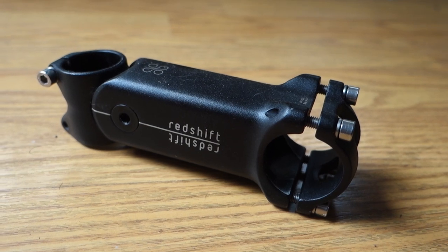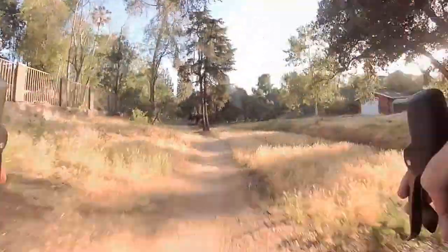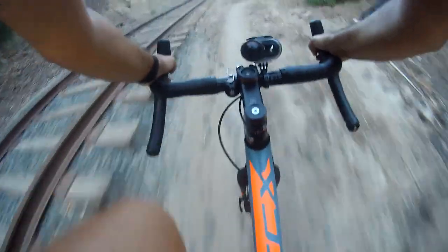All of these products I have reviews for on my channel and I'll be putting those links in the description below. Let's get started with the Redshift Shock Stop Stem. This is something I would definitely recommend to any gravel bike rider that wants to add more comfort, or is having any kind of shoulder, neck, or hand pain on the gravel bike on longer days out in the saddle. This is an elastomer-based stem that is going to add 20 millimeters of compliance. They have this stem available from 80 all the way up to 120mm in a negative or positive 7 degree, and it is tunable depending on rider weight and handlebar style. I have run this stem since it came out and I absolutely love it. I would recommend it to anybody who wants to add comfort to the bike, or even a long endurance road rider trying to reduce fatigue — it really is a game changer riding off-road, and I would never go back to rigid if I didn't have to.